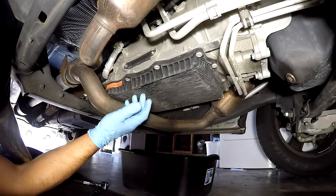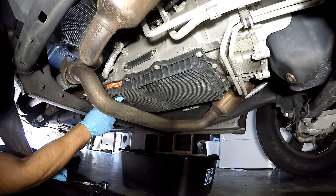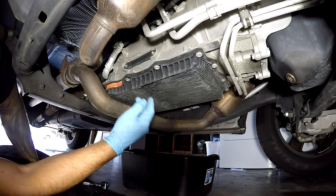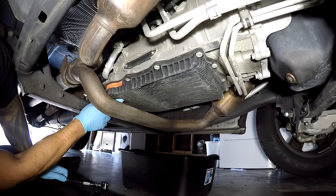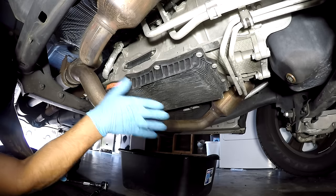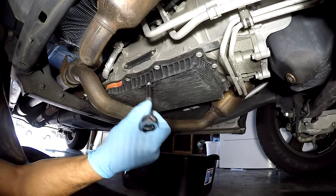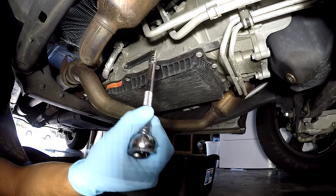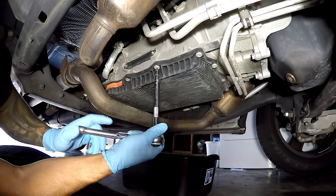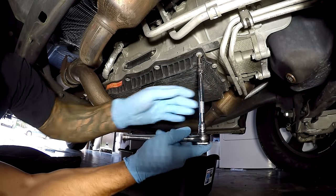Okay, so since I'm removing the pan anyways, I'm not going to bother with the drain plug, which is a 10 millimeter. This fill plug is an 8 millimeter Allen key. So I'm not going to bother with this, because if I let it out from here, it's just going to drain all over this exhaust pipe, and then it's going to end up smoking, and you know how that story goes. So rather, I'm just going to remove the bolts, and it's obviously going to leak out one of the corners. So I think that's preferable for me. This is a T40, so that is basically it. I'm going to remove these bolts,